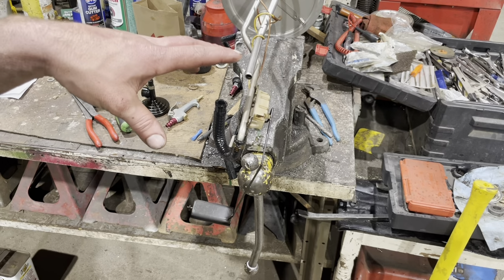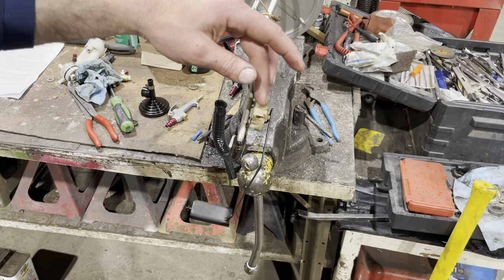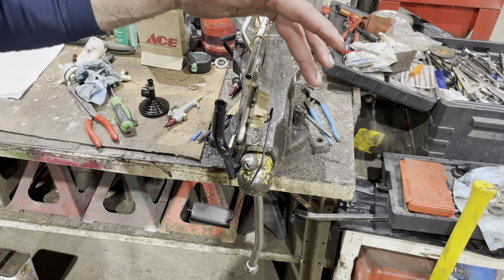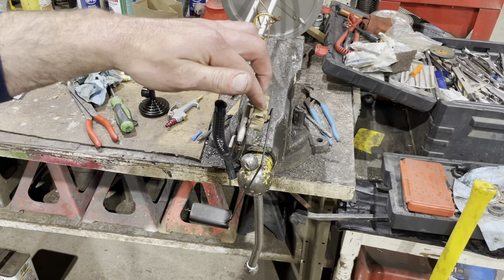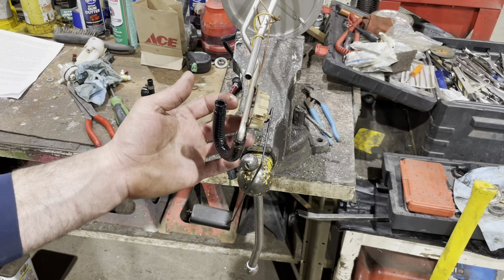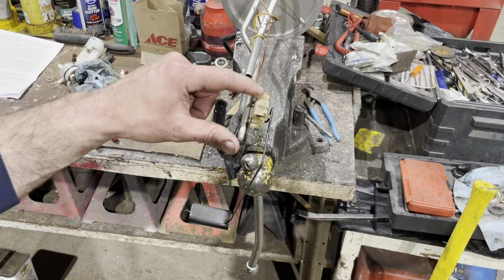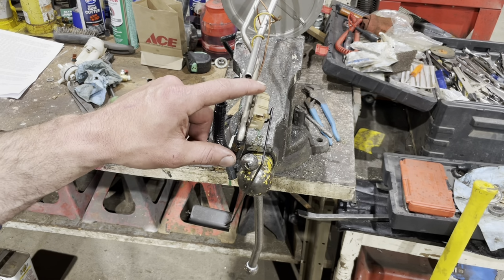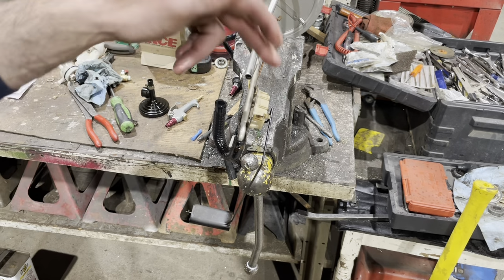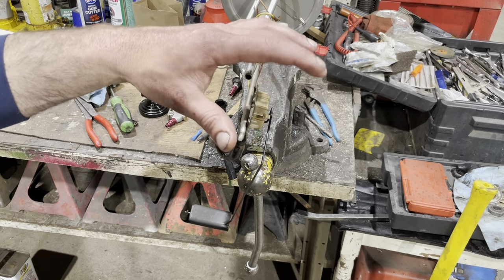So now that that's all off, we're ready to put the new parts on. Be extremely careful with this. I'm actually working on another video right now where someone broke the ceramic piece. Actually, I broke the ceramic piece on a Ford F-750, and the dealership wants $1,100 for the sending unit, but I found a $28 part that will replace this. So stay tuned for that video because it would also apply. They use the same sender since the mid 80s on Ford with the same resistance values.